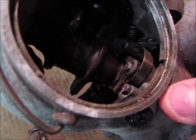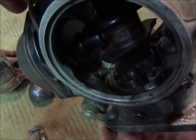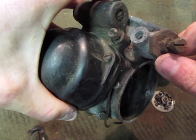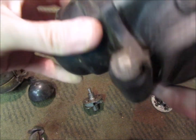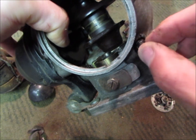This one's pretty tricky — you have to set the points with a timing jig. I've got one of them; I did a video on that somewhere, I'll put up the link. Point adjustments are right in here. We've also got the advance set, the vacuum brake, condenser, and coil. You can actually do the adjustments through these rubber plugs, which have gone funny.